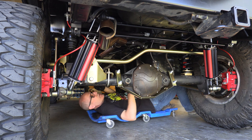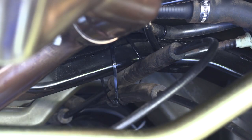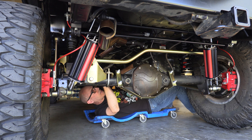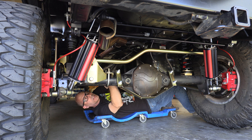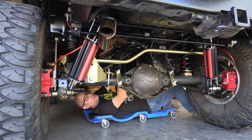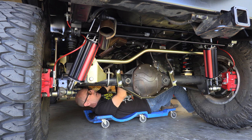Let's get underneath here and let me show you what we're going to target. This is where the parking brake cables go over this crossmember right here. They go over stock, they go over the top of this crossmember and then drop down and split back to each tire for each of the parking brakes. The trick I'm going to show you is how to get them to dangle down here and help get you the droop you need. Because these are set for stock height and stock suspension, and once you start adding lift and droop, these stretch and can cause problems. We'll take the wheels off and I'll show you how to actually take them out.